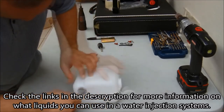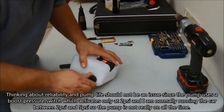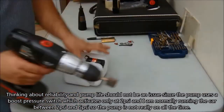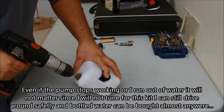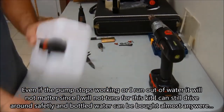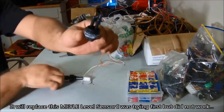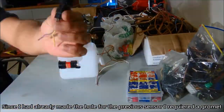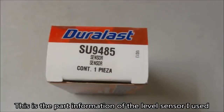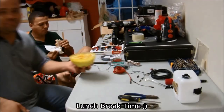The car will not be tuned for this specific system in my setup — we're adding this to dissipate heat from the charger. Some people will say throwing water directly at the blades will damage the charger, but realistically that won't happen quickly. People have been using water injection for many years on airplanes and cars. This new sensor I'm using is the basic type that AEM and other water injection kits include. I got this one from AutoZone — here's the part number if you need it.